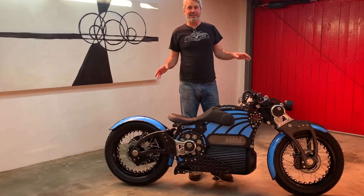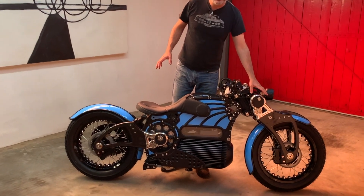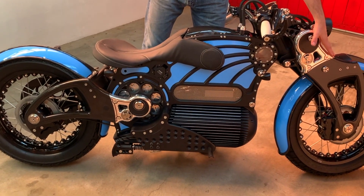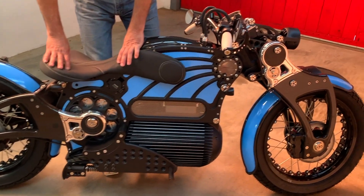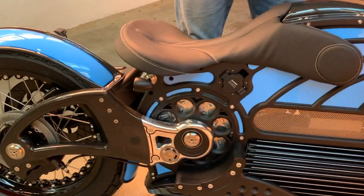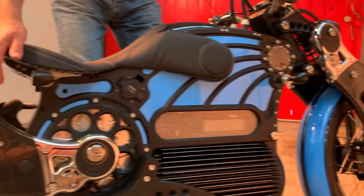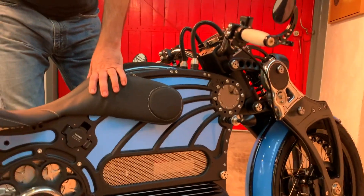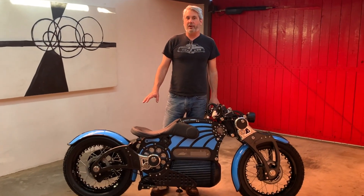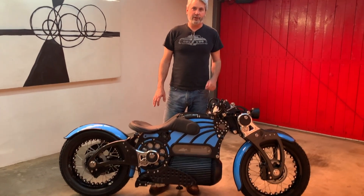Let's have a look at one of these plates — let me pull one off for you. The suspension on this motorcycle is unlike anything else out there. We're actually using girder blades in multiple locations. If you look at this multi-link style front suspension and the suspension member, it's exactly the same as the rear suspension member. Not only that, it's part number one, quantity four — so there's no difference between this part left and right, or front and rear. We're showing carbon fiber girder blades on this bike; that's optional equipment, offered in summer 2021. The initial launch bike will have an aluminum girder blade.